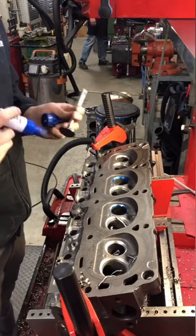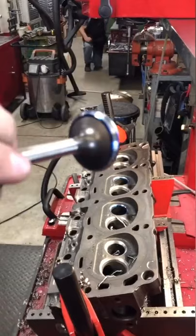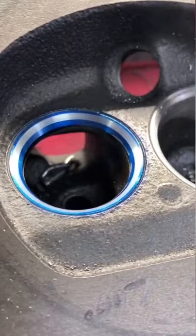When I put the valve on the seat and do the lapping motion, the magic marker rubs off the valve and the seat where they're contacting each other. This helps me visually see where my seat is contacting the valve face, so I know whether to increase or decrease the diameter of my cutter.